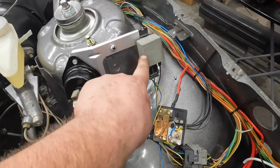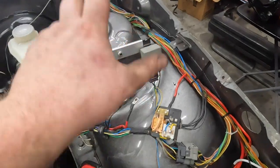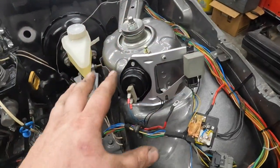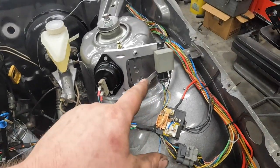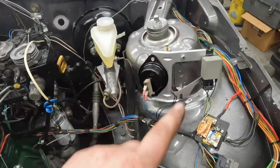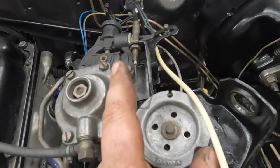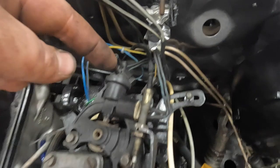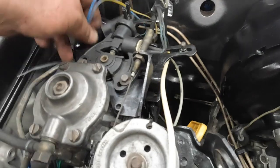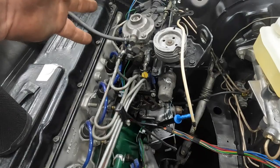So speaking of not doing anything — the EGR relay, for exhaust gas recirculation, that's emissions nonsense which we don't need. Know the laws where you live — it might get you in trouble, it might not. Here I don't need it because diesels don't get emissions inspections, which is convenient. We'll tidy that up and get rid of it. Also this vacuum switch and the little idle switch back here — pretty much all these wires can go away because that is all part of the EGR system which isn't going to exist anymore.